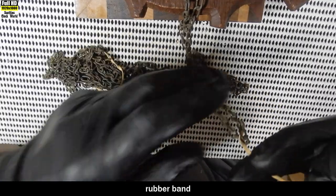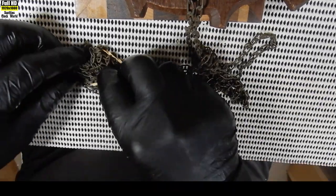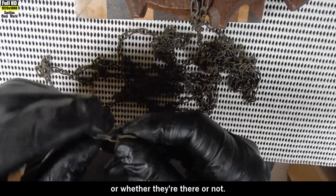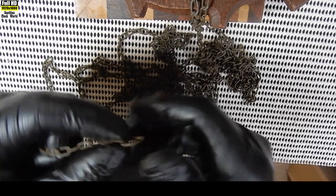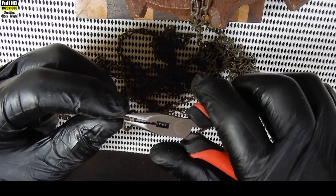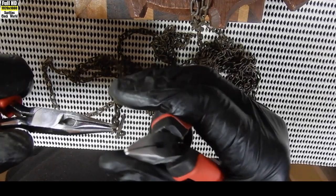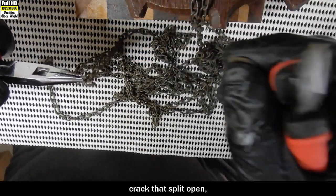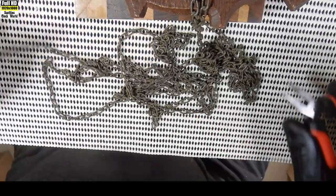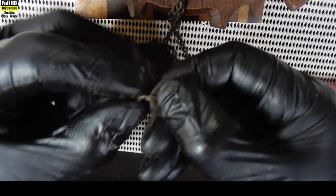Now I'll undo this extremely perished rubber band and find the other end of the chain — both of them — and see if we can find the stop rings. There's one. We'll remove that. It's split there — hold up with a pair of pliers, another pair of pliers, crack that split open, take the link out. They'll need some work with the Dremel before they go back, that's for sure. Close that link up — that's the first one.